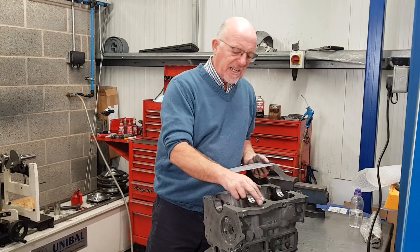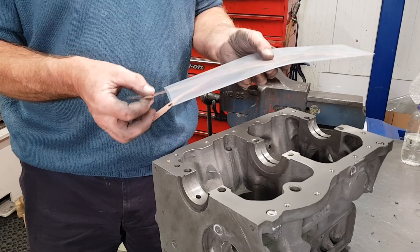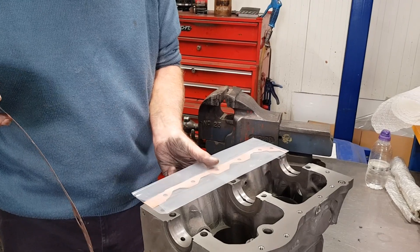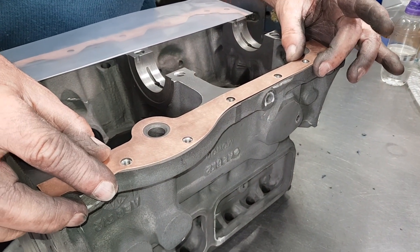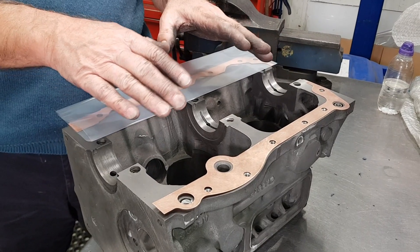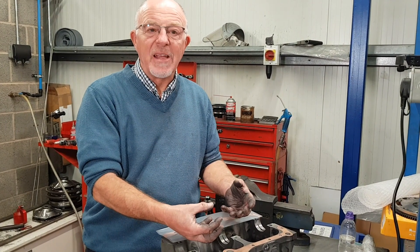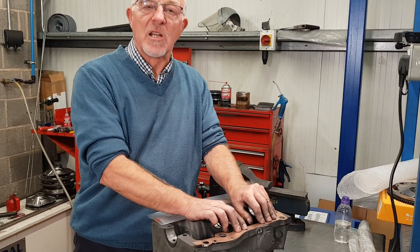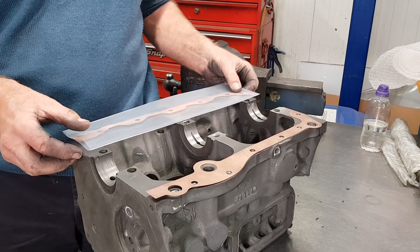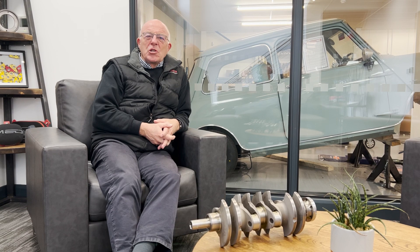Now we've opened all 12 sump holes to 5/16, here are the copper sump gaskets we've produced — copper sump gaskets with the holes already cut out to 5/16s — and they fit absolutely beautifully. You're not going to have a gasket fail because of crankcase pressure, which does happen. On paper gaskets the pressure inside the crankcase blows them out, but with these being solid copper they will never ever blow out — a complete and utter gasket seal. That's the 5/16 sump preparation all complete. On the next video we're going to run through the steel main caps and the line boring. Thanks very much for watching.